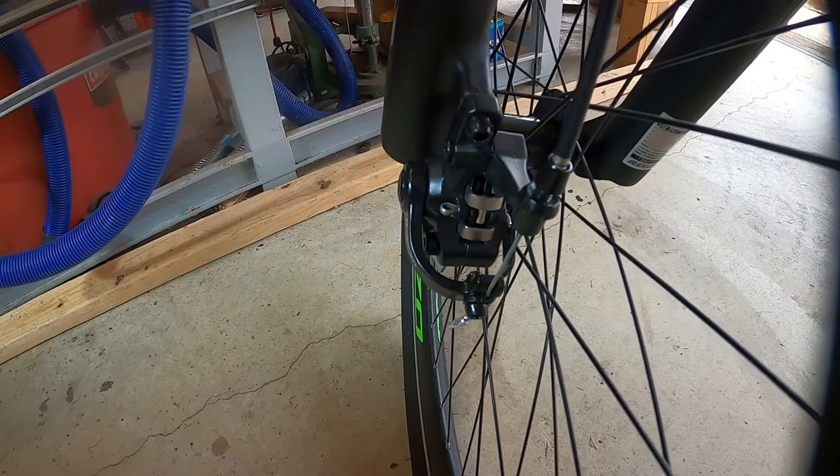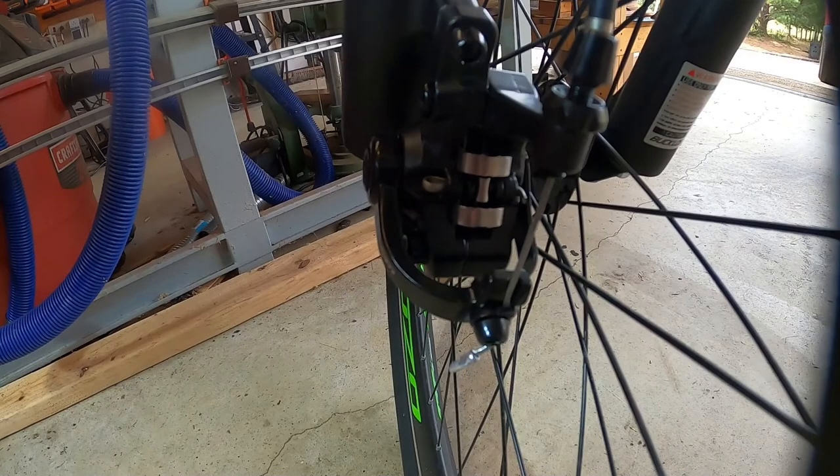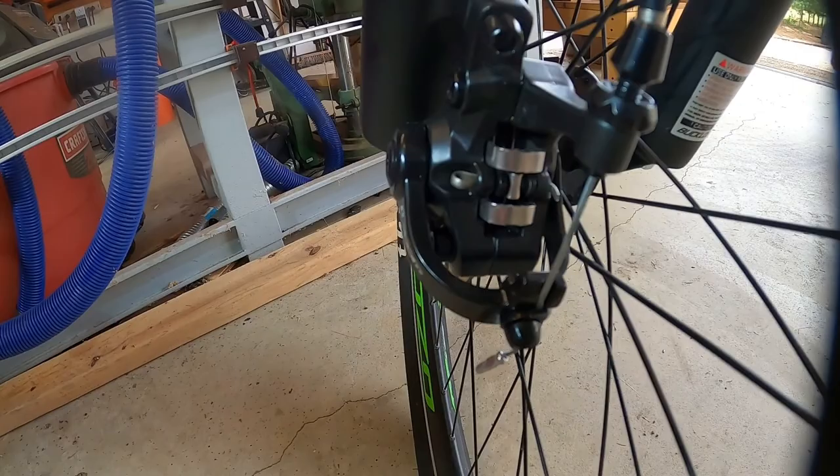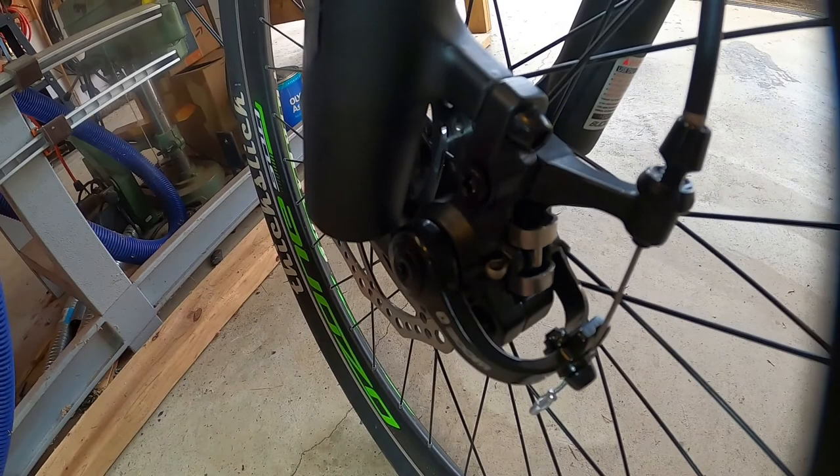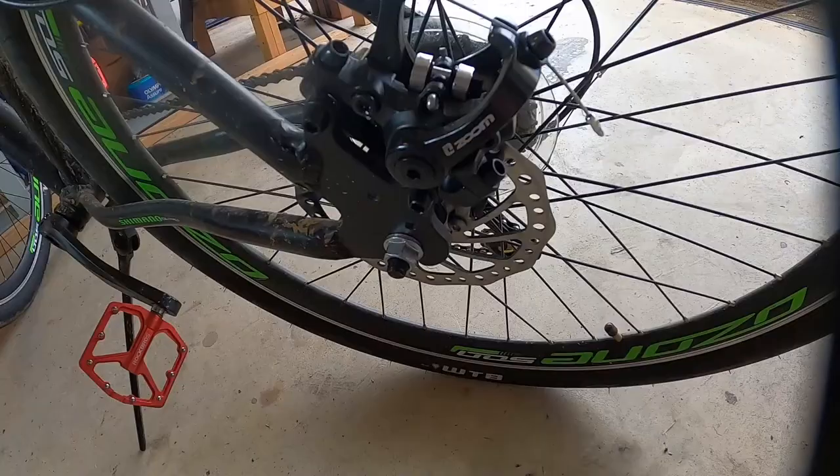There are the front brakes and I'm really pleased with them. They're dual-pull, so the pads come in from both sides and squeeze the disc in the middle. The old ones were single-sided and not floating calipers — these have made a huge difference in the braking feel on this bike. It's much more positive and much crisper.